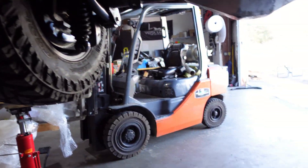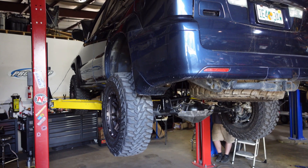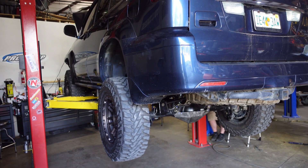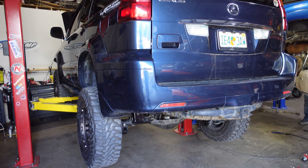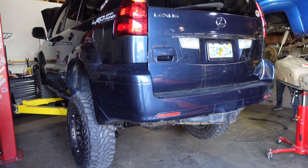Let's go ahead and let it down and take a look — see how much further the rear axles are dropped over the front axle. That's the Dobinson long travel suspension back there. I already had a three-inch lift from Dobinson; to go long travel, I changed my shocks out from regular travel to the long travel shocks Dobinson provides.